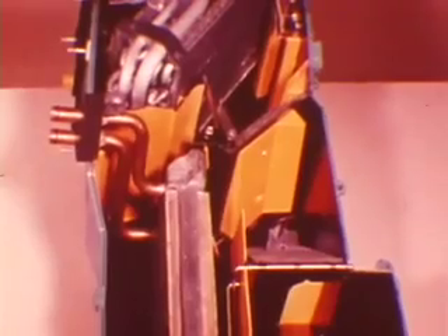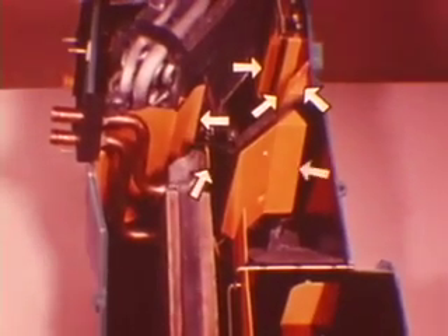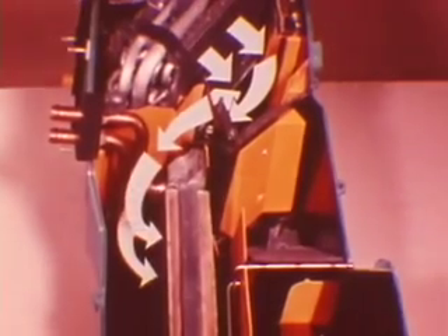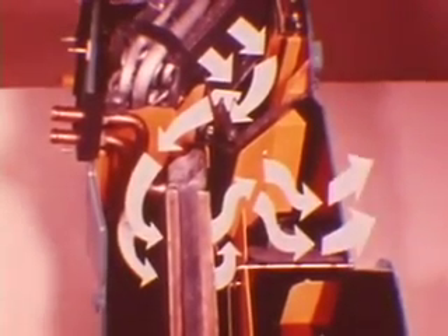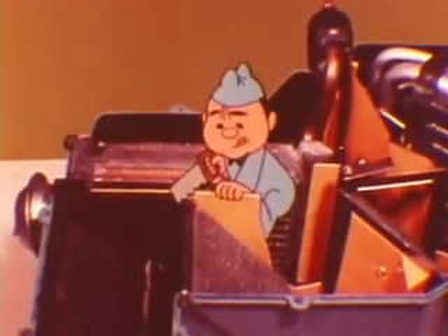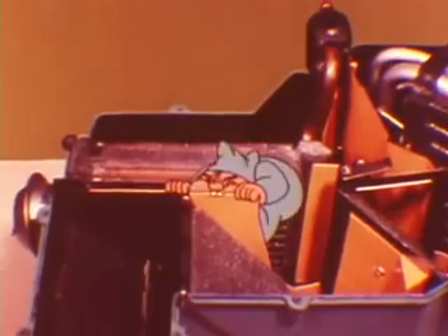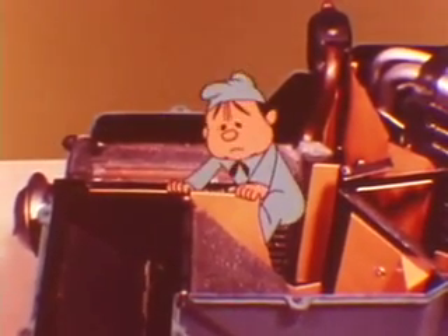The housing lid and walls have baffles designed to improve heating and cooling balance and airflow travel to all outlets. As air enters from the blower housing, the walls and baffles channel the airflow through the evaporator and/or heater core and through the balanced ductwork to the passenger compartment. Don't get any ideas about modifying the walls or baffles to improve airflow. Their shape, size, and locations are designed to obtain the best airflow and distribution and should not be altered for any reason.